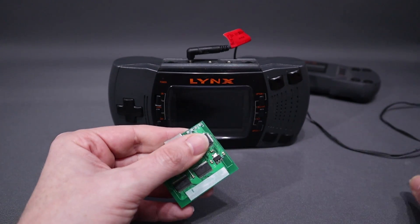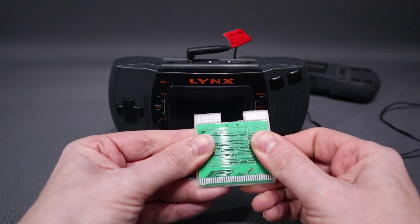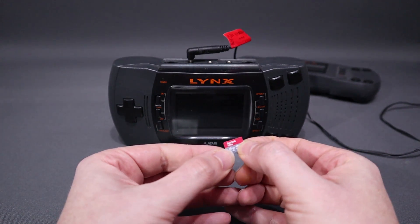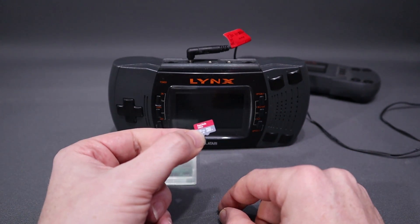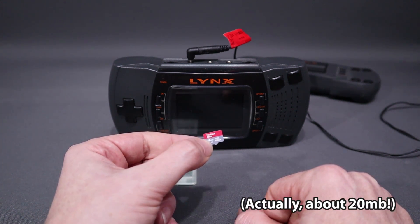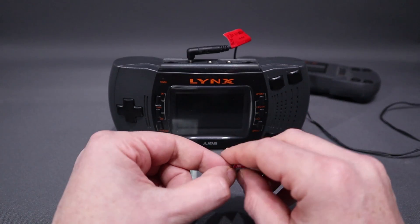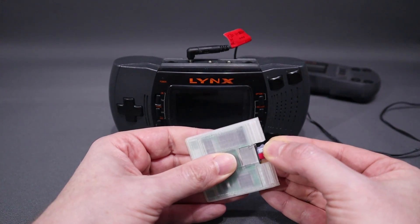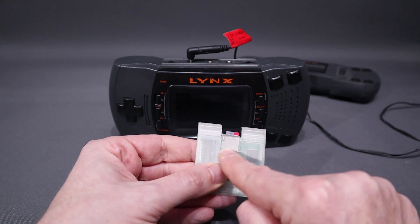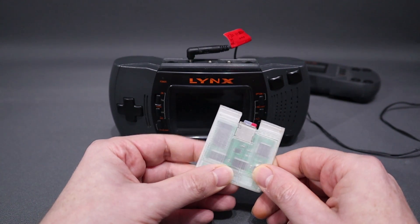I believe this is a tiny little ARM processor and some accompanying logic chips. All you need is a microSD card — I have one here. This is a 16 gig one, which is massive overkill because the entire ROM collection for a Lynx is only a few hundred meg if that. But when I went down to JB HiFi to get a fresh SD card it turns out 16 gig is about the smallest you can buy now. You just put it in there and all you have to do is put a boot.bin file on it — which handles the menu system — and then just ROMs in LNX format.